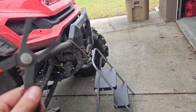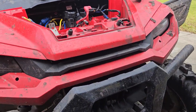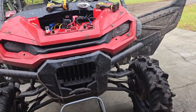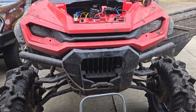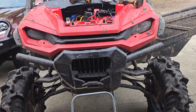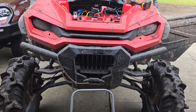It's worth noting that this thing was fine about overheating until I had it completely submerged in really goopy mud for a long period of time, just pumping mud into there. Never had any problems until that happened. And then since then, if I run it real hard in sugar sand, it does get hot. So we're going to pull the radiator, put some fresh coolant in it, and fix this overheating problem once and for all — until I get in another muddy hole and do it again.